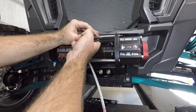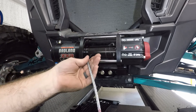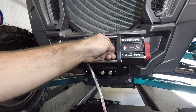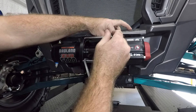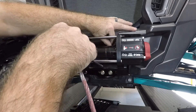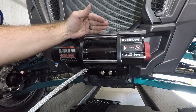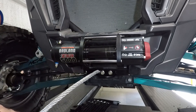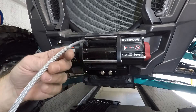Now your winch rope needs to be coming out of the top side of the drum. If it was spooled coming out the bottom, it's not a big deal — just unspool all of your rope. There's usually a set screw in here; this one's an eighth inch Allen. Loosen it up and flip it around so it goes in the other direction. Once the winch is wired up, you can spool it back in. You should always pull all the rope out and re-spool it onto the drum whenever you install a winch, whether you're changing direction or not, to make sure the rope is properly tied on the drum so it doesn't get caught and tangled on the first use.